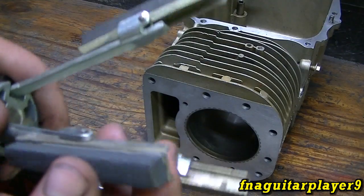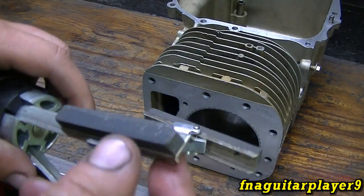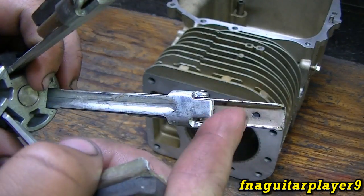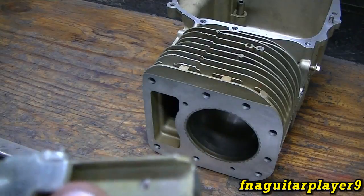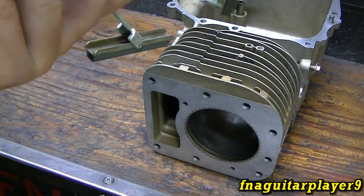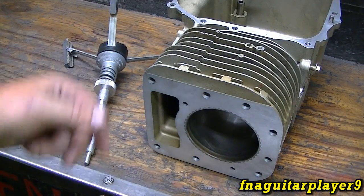You want to inspect your stones. This one hasn't been used a whole lot, but you'll start seeing wear on the corners when they start wearing down — kind of like how this other one is starting to. You can usually replace these; they're just pop-riveted on. Some of the cheaper hones have them glued on, which is why I went with the Crossman — the riveted stones indicate a little better quality.